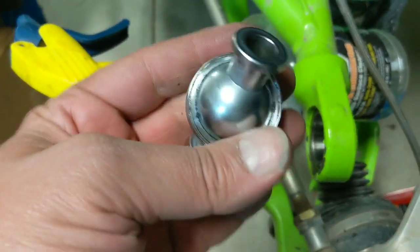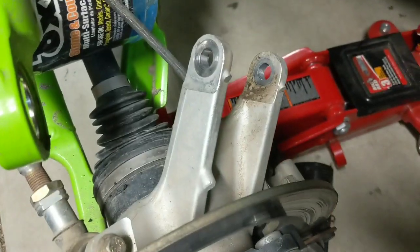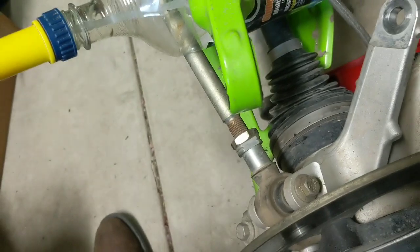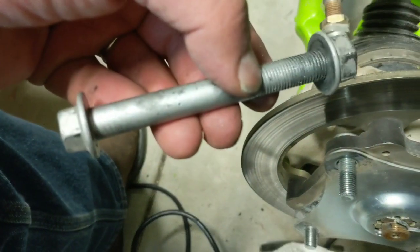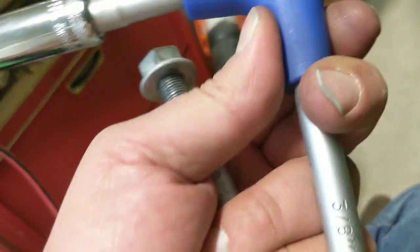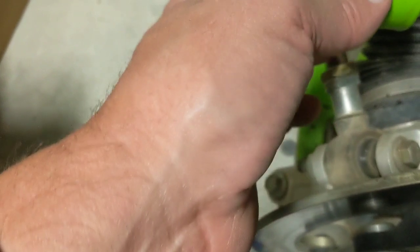This is a wear item, it's 30 bucks — big deal. You're gonna pull the wheel off, then undo the top yoke joint — I think it's a 15mm and an 18mm. Let me just make sure — yep, 15 and 18, not too torqued down. Pull that off.